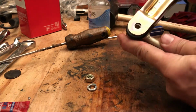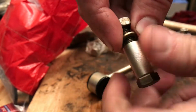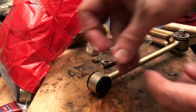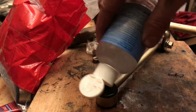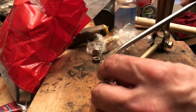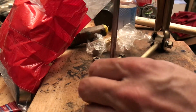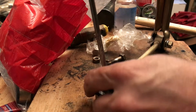And once we have this sleeve into the bushing, it's simply a matter of inserting it into the bracket. Then while it's on the bench, this is the bushing that's going to go inside the A-arm. It's a lot easier to put into the rubber of the drop link while it's on the bench. So we'll just take it off and fit it in here. A little bit of glycerin, or a lot of glycerin. And I'm just going to put the screwdriver in here for a little extra leverage, and just get it started in the hole. And it is.